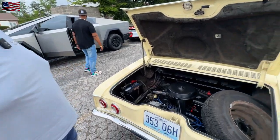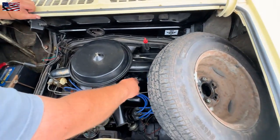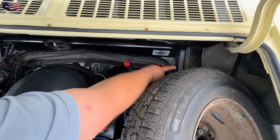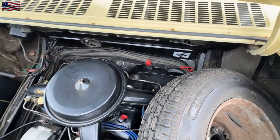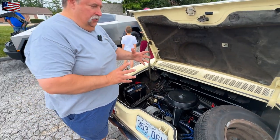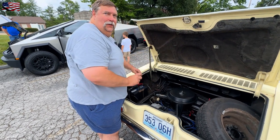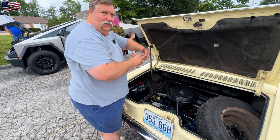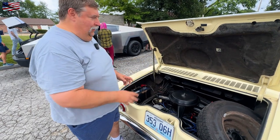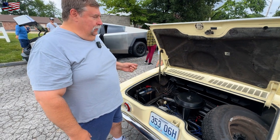Okay. And I'm assuming this is oil and that? Yes. I see one's transmission, I'm assuming this maybe? This is oil, this is the transmission fluid, and this is actually the rear axle. Oh, wow. And interestingly, most cars you have the engine, then the transmission, then the differential. These actually have the engine, differential, and then the transmission is actually in front of the differential. And there's a shaft within a shaft that spins. So this has a dipstick for the differential oil. And then obviously one for the transmission. Boy, the engineering that must have gone into that, putting the differential in it.